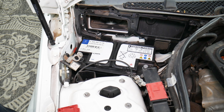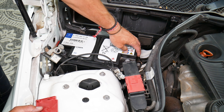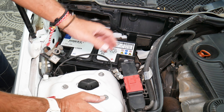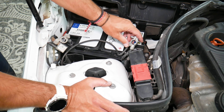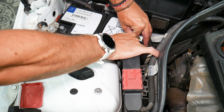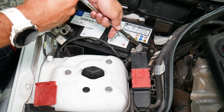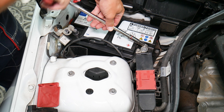When you connect the battery terminals, make sure that the battery is mounted and not movable — because if it moves, you can touch it to the body and burn modules that way too. Get the positive terminal and that will be the first one to connect. Make sure it's good. Do not hit them with hammers or anything like that, because that can damage the terminal and the battery you just installed — maybe a brand new battery.